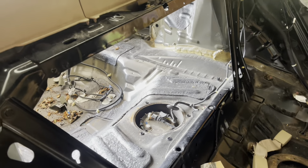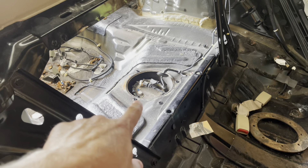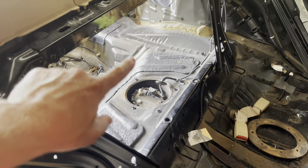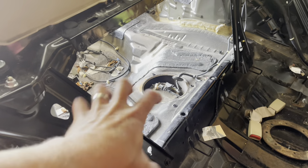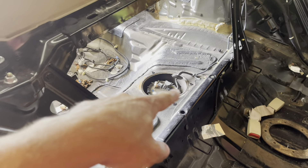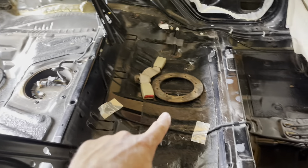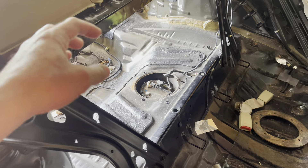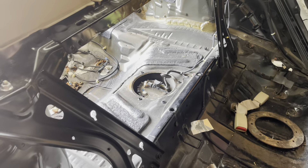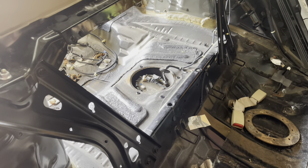After we do the glass, outside so we don't make a mess, we're going to carefully use the sawzall and cut back the top of the car there over the tank. The fuel cell should just unscrew and pull out once I disengage the main fuel line. Then I'll cut out with the sawzall the top section I need for my derby tank ring, so that will sit in that part of the tank. Then the fuel cell will just slide back in and tighten down. That's the plan — we'll do that outside.